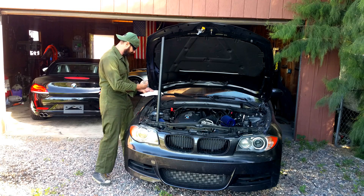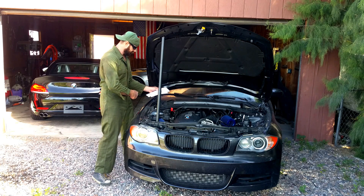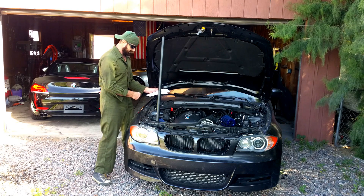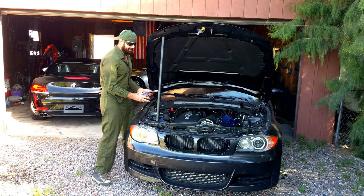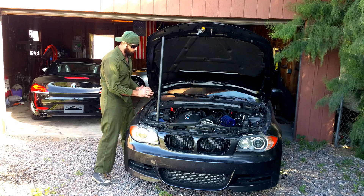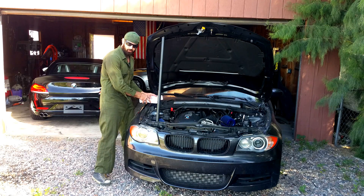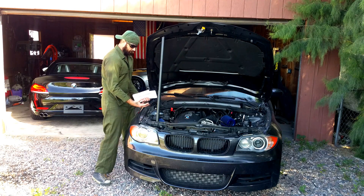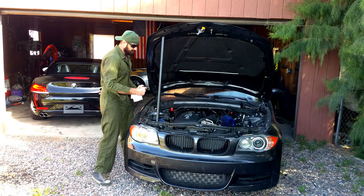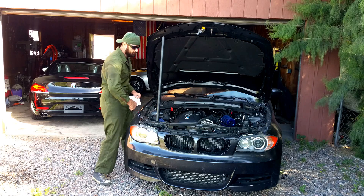You have options like the precision 5862, 6262, 6266, and the 6766. Personally what I'd do is get the 6766, but make sure it's a dual ball bearing ceramic ball bearing turbo — because you'll have the spool of a smaller turbo while allowing you to have a larger turbo, so you can have major power. That quick spool because you don't have a journal bearing is your way around eliminating a lot of lag. Dual ball bearing turbos are also more reliable, and having a single turbo means you have one turbo less to go out.